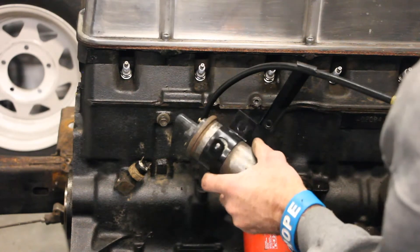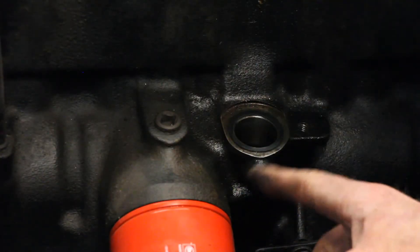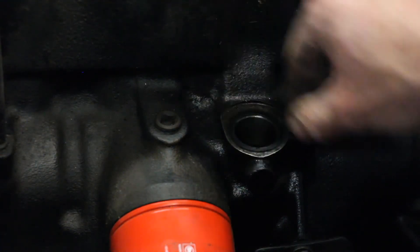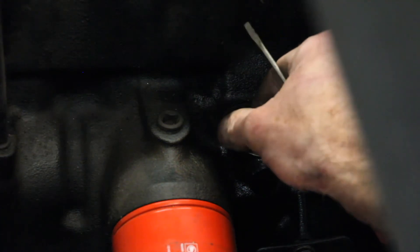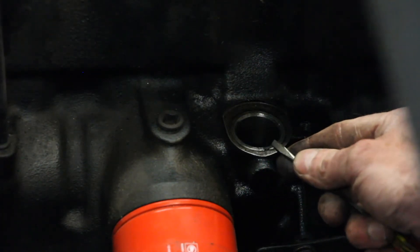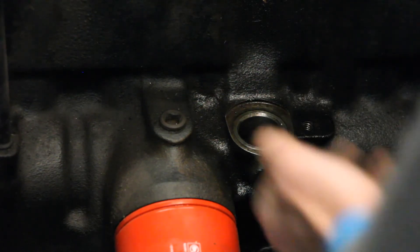Here's your coil. It's held in by this one screw that connects the two pieces of the actual bracket, the holder. One thing of note: when you take your distributor out, there is a little tiny gasket — a hair-thin gasket that actually sits right on top of this. Be very careful when you take it out. It's just a simple, very thin rubber gasket, almost paper-thin. Obviously you want to clean this up. Make sure you don't get any gasket material down in there because that's your actual crankcase inside there, and that wouldn't be good for your pistons. Depending on where you are in your process, you might want to put something in there — like a cloth or a paper towel — to keep whatever debris you get off the engine out.